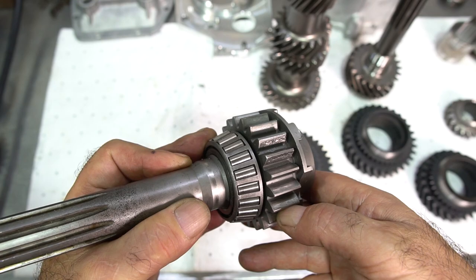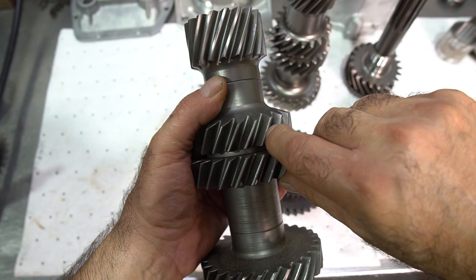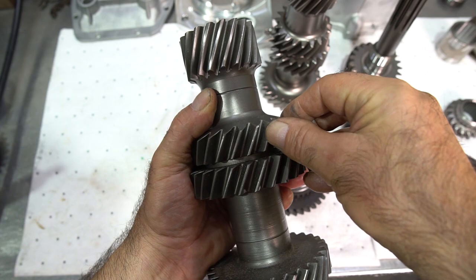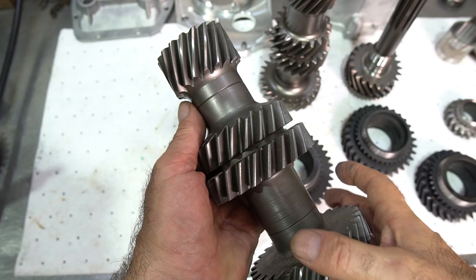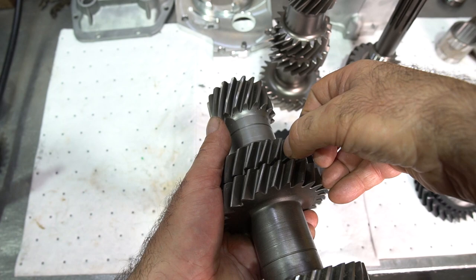Here I've got a counter gear, and it's hard to see, but it's been banged up here. If you see little indications like this where it took a shot — could have been in shipping — you can feel a rough spot when you run your finger over it. This is very subtle and a lot of people don't pick this up. What happens is when you put a transmission together with gears like this, they'll probably work fine but you may hear a ticking or knocking noise. You use a dress-up tool to come across it, smooth it out, and eye it up in the light.